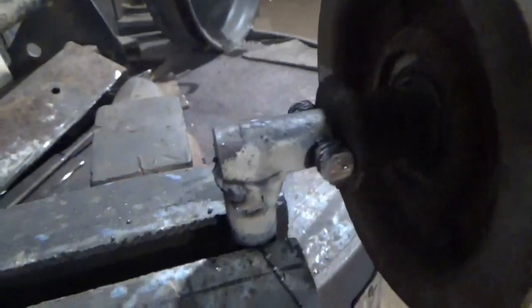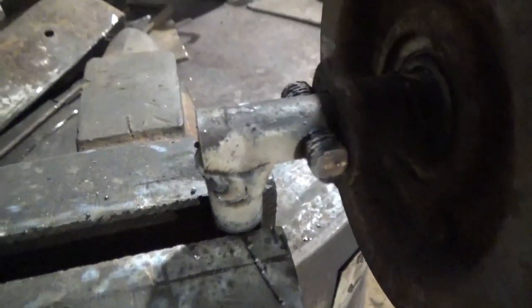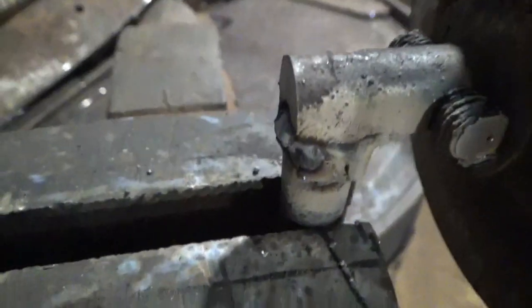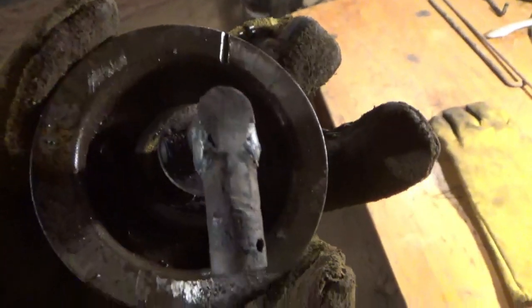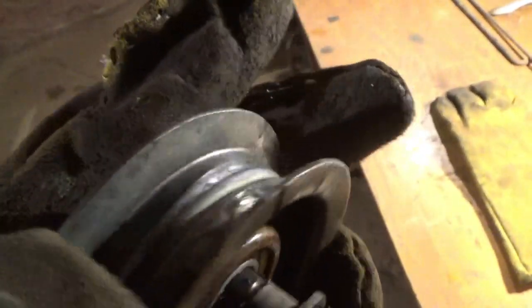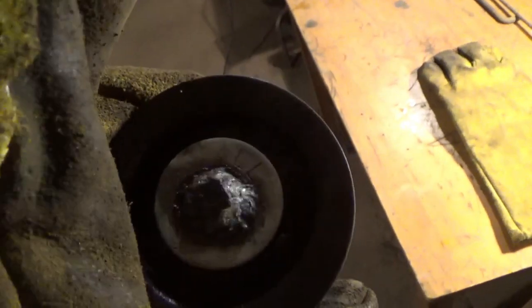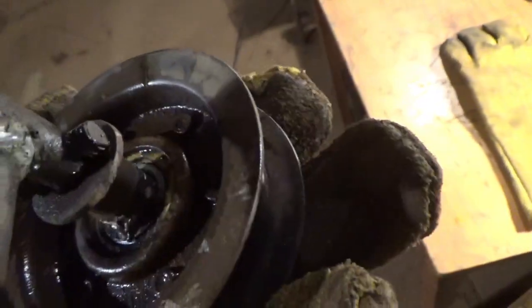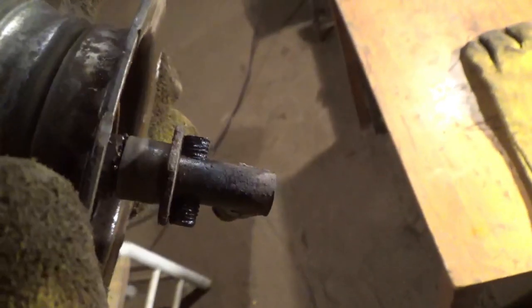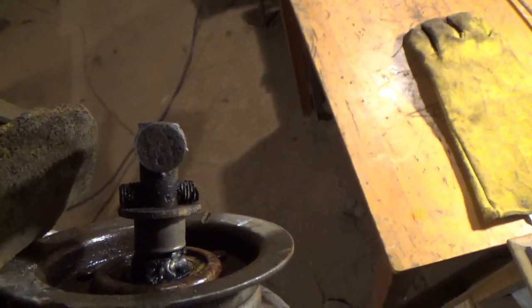Alright, we have our L-shaped bracket made. All I need to do is grind off a little bit on this end so it sits flush, then we can put it up in there, adjust it, and weld it up on the frame — then we'll have our chain tensioner. Got our surface shaved down. I actually gave Shaggy this pulley to make a flat idler for a snapper deck, and that's where it came from. I took it off and I'm going to use it as a chain idler — that surface is nice and flat. We're going to weld it up just like this, straight up and down, so the chain doesn't try to pull it down.